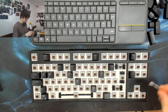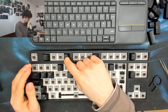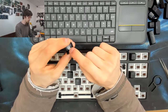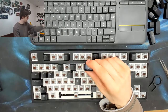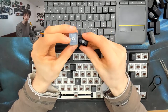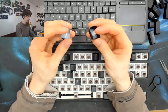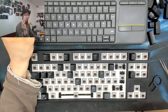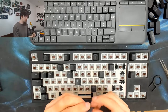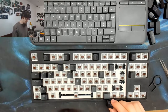These don't feel like the O-rings are going on properly. Looking at it, these new keycaps have slightly longer stems - the O-rings are getting pushed right to the top of the stem. Comparing to an old keycap, the old one has a cross at the bottom of the stem stopping the O-ring from going too far, whereas the new ones don't have that. So these keycaps may legitimately benefit from being double O-ringed to space them out, because the O-rings really don't feel like they're doing anything.